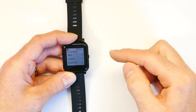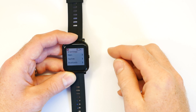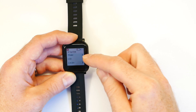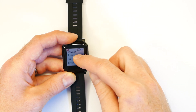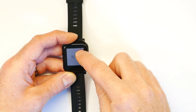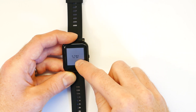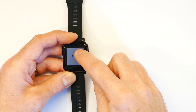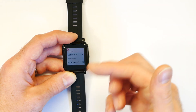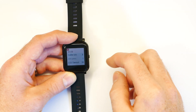There's the settings window here where you can change a lot of stuff about your watch. One of the things we suggest you do at the start is go to LCD and calibrate, and you tap your finger where the crosshair is. You just have to do that 12 times in order to calibrate the display. Different people press the display in different ways and it helps to ensure that the device registers taps where you expect them to be tapped.